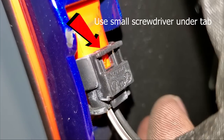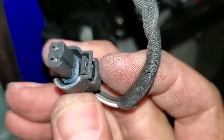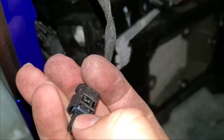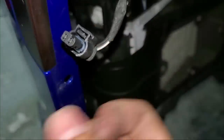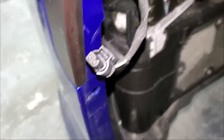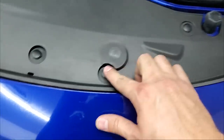Now that we got those screws off, go ahead and pop off your side marker here. That was kind of a pain until you know what you're doing. That clip right there goes on, so you have to basically get a little screwdriver up under that little black piece of plastic. You have to lift that part up away from the orange plastic — you kind of got to do it blind a little bit around the corner, but with a little bit of pressure it just came right off. Across the top you're going to want to go ahead and remove all these push pins as well.